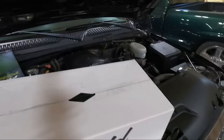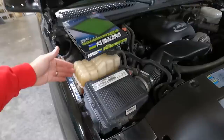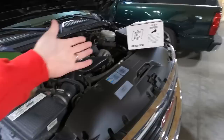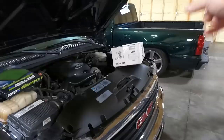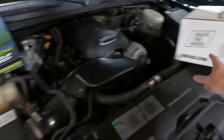I don't have a lot of faith in aftermarket cold air intakes. I don't think you're getting a ton of performance when you open up a filter to under-hood heat. What we're using today is called an MIT, and I'll list this stuff in the description — both the Air Raid and the Green Filter. This requires you to have electric fans; it will not fit with a big factory fan shroud, so don't buy this if you don't have electric fans.